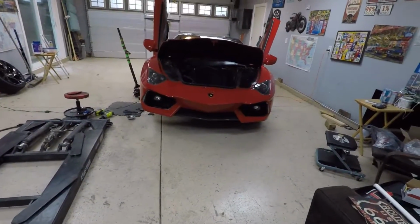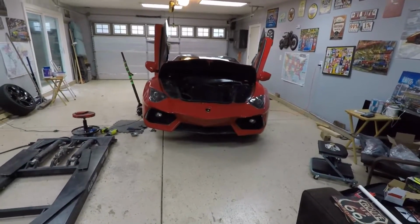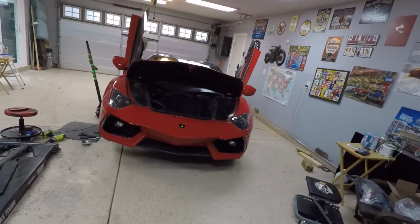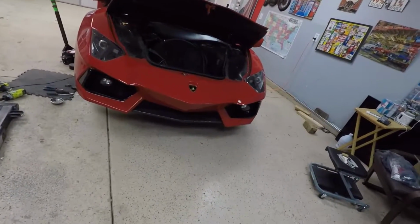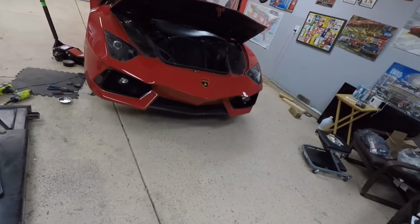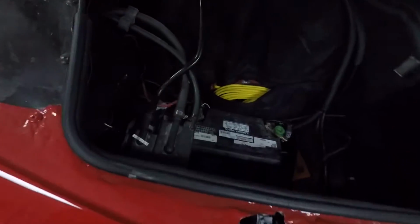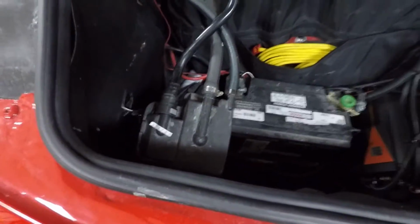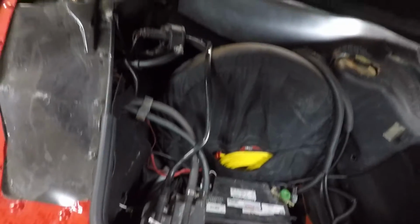This is about emission problems on the Porsches, the Boxster and 911. But this is the Porsche Boxster, a 2001 Boxster S, underneath all this. Your problems won't be half as complicated as mine, because you didn't move anything like me. I took this emissions canister that was in the wheel well and moved it to here. Also with the two sensors, this mechanism is moved, and then I connected it all back up.